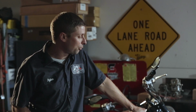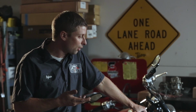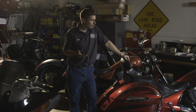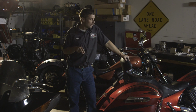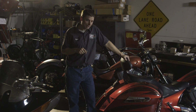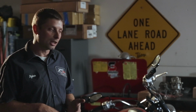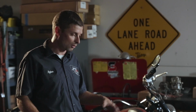And so you'll see that my maps are broken down into exhaust and the different cam options, and really that's about it, because we just assume that you've got Lloyd's timing wheel on there and Lloyd's air filter, because you'd be a fool not to. All my maps include that. If you see HOH bits on the maps, HOH stands for Hard on Horsepower, which is Lloyd's. So if you see a map that says HOH bits, Vance & Hines pipes, that would be a stock cam bike: any Cross Country, any Cross model with the Vance & Hines pipes, Lloyd's timing wheel, and Lloyd's air filter.